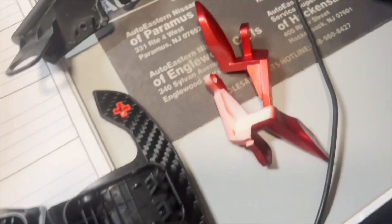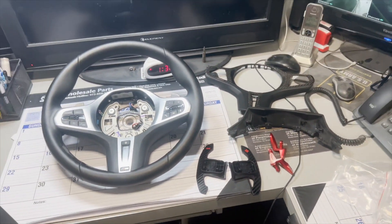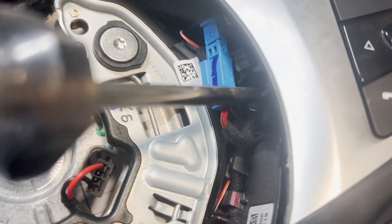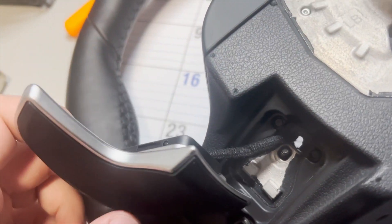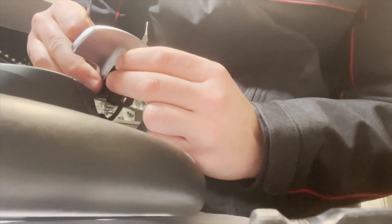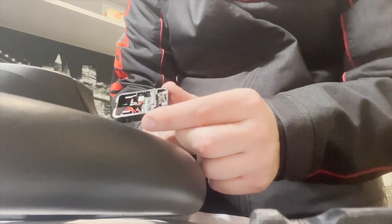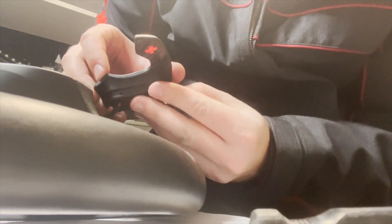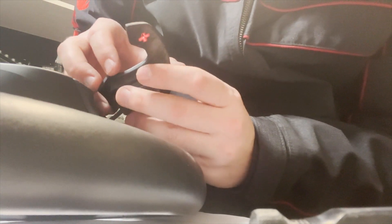When we have our steering wheel off completely, we can start working on it. I'll be starting first with the paddle shifters. Here I'm showing you the location of two bolts that you have to remove, and once you remove them with the T20 screwdriver they're just gonna fall off. If the paddle shifter is off, you just have to take out the plastic rod — not on the flat end but on the more circular end — and use anything sharp and pointy to pull out this plastic rod that holds it in place. Once this rod is out, the whole thing will just fall apart. Then you can use your aftermarket paddle shifter. Be very careful with how you align it so the plastic teeth go inside. Once they're inside, it's gonna become flat, and then you're gonna use the plastic rod you took out originally to put it back in so it holds it in place.